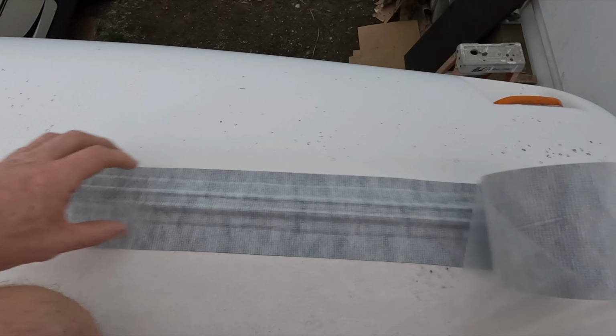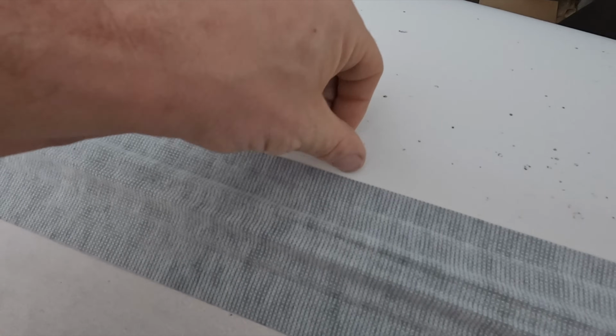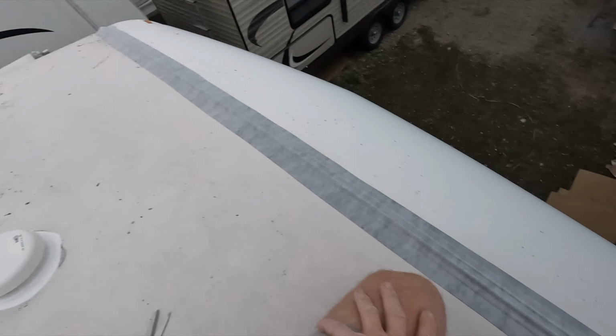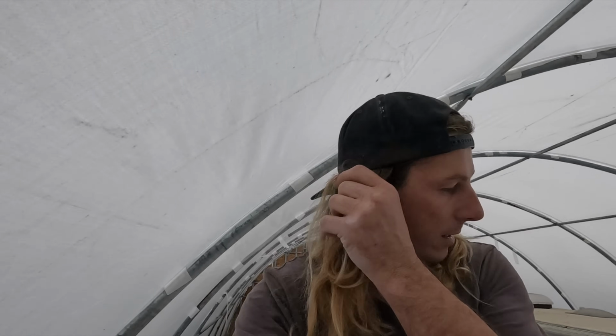This here is just straight on, and it covers over the seam, so it's doubly protected now. So now I'll just mask off a line across here, just in front of the seam tape, and paint the liquid rubber straight over the top. And I've got a perfectly straight line and a solid 4-inch strip of waterproof membrane straight across that seam. So man, this is gonna be epic.